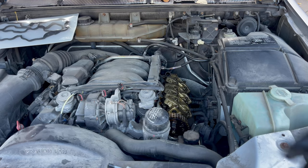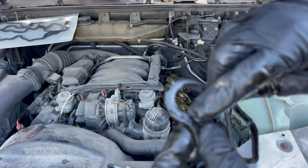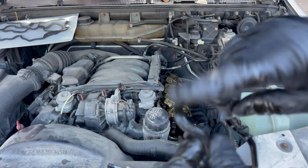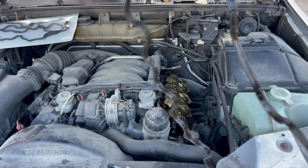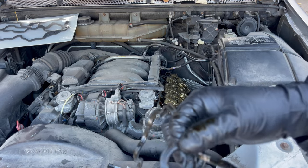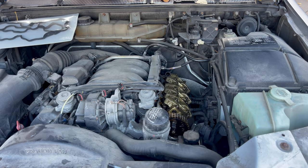Well, look at here. Okay, this has a little chunk out of it. Can you see? I think the oil was disappearing through here. Because if you put this, this is how it goes on the car. This is where the oil leak was, and there's a chunk coming out right there. So I think we fixed it.